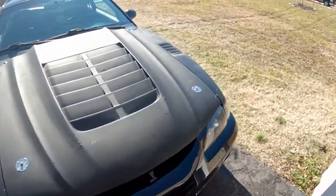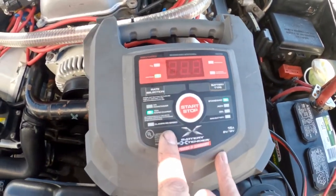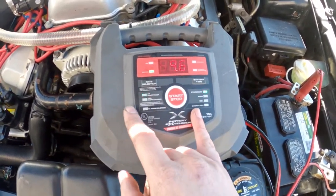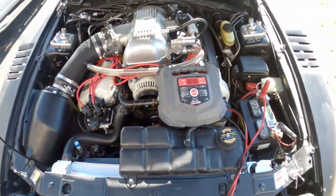Alright, got it all uncovered. Let's get in here and see if it starts — I doubt it will. Nope. I think this little lawnmower battery is checked out. It's reading 9.7 volts — a little bit lower than I thought. This battery is not too happy anymore. I'm going to put it on a rapid charge because we ain't got time for a maintenance charge.